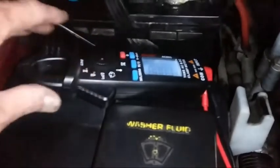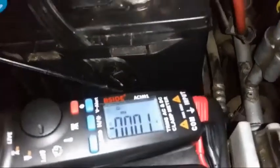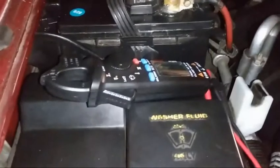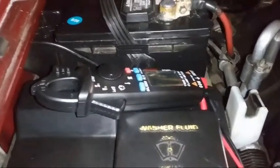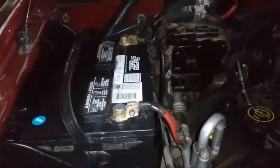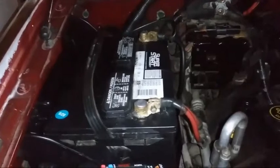Okay, it's got its own light on it. That's one of these clamp ones, too. Anyway. And I connected up. I actually used this one to see the draw, and I was getting the draw. It was dropping. Charging, with the vehicle running, it was 14.4, 14.7. So my alternator's charging the battery. Now...